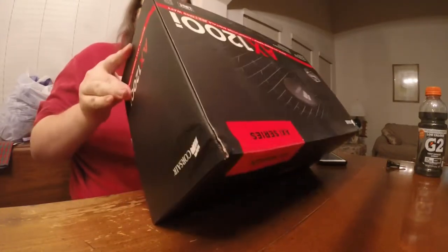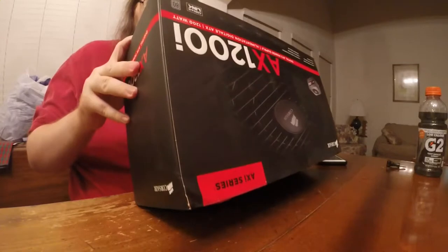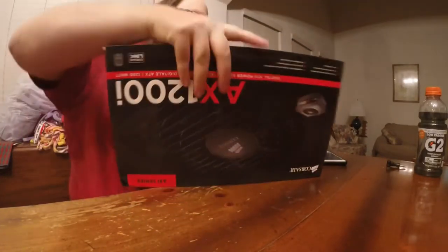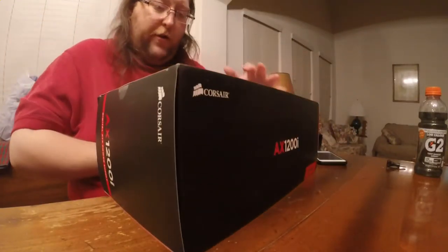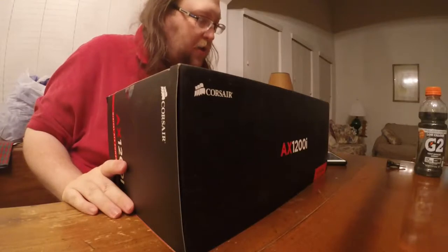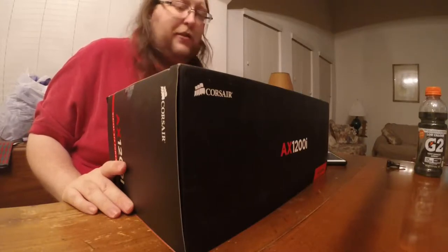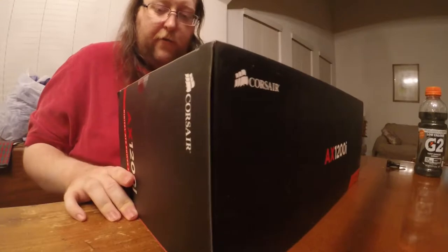There's a digital signal processor, so it has tighter voltage regulation and results in a much cleaner power signal. Let's talk about the power ratings, because it's something that not a lot of reviewers go over. Current is 15 amps AC, with input 100 to 240 volts, frequency 50 Hz to 60 Hz. For the output ratings on DC, you have 30 amps and 30 amps on the 3.3 and 5 volt rails, with 180 watts drawn by those two.